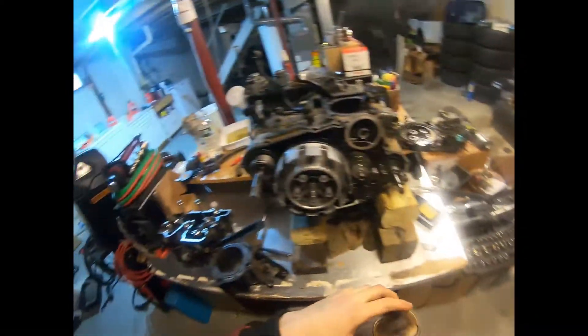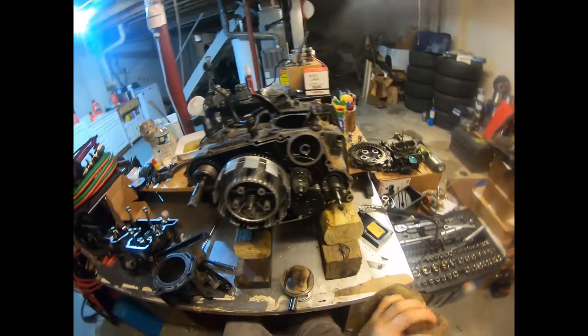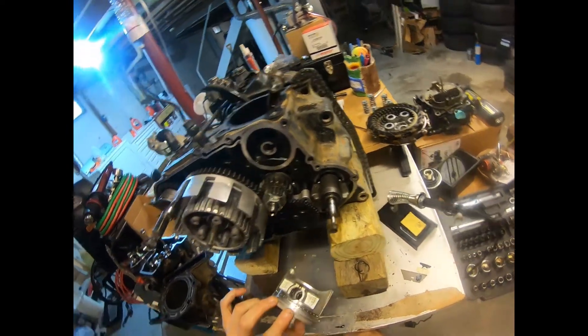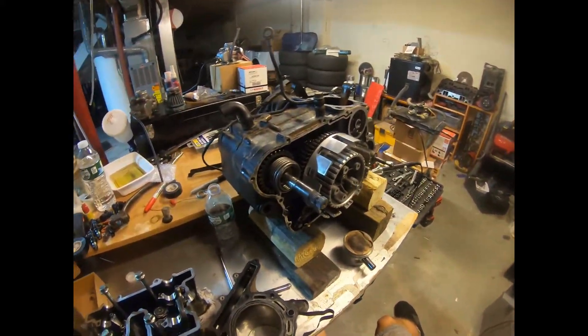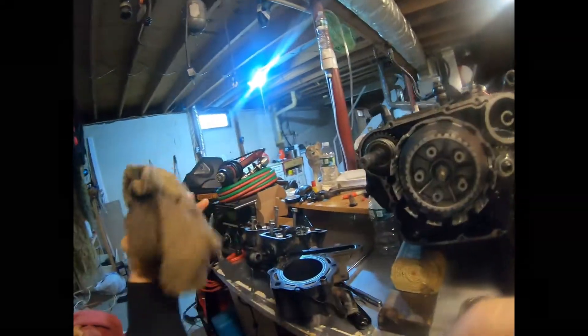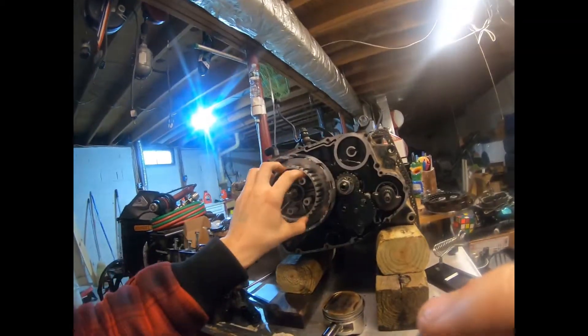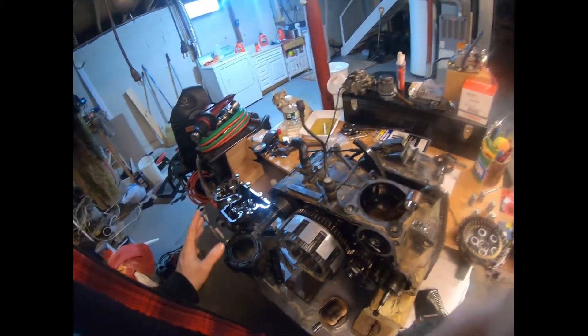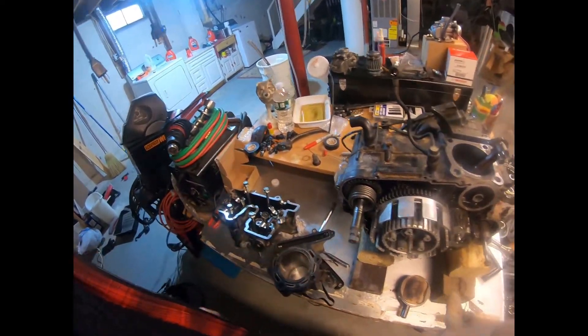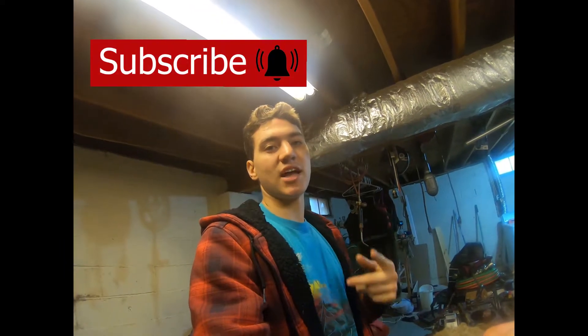We got the clutches out, we got the piston out, everything here looks actually really good. I thought I was going to open this up and it was going to be all black, with the rings maybe all burnt up - not looking good. The only problem I see is the valves, and honestly the valves could have been where the oil was burning from. So next video we'll probably be taking off the back cover, checking the fitment of the piston into the cylinder wall, and I'm going to find an engine shop to bore this out a bit. Please leave a like, comment below, subscribe to the channel, and I'll see you in the next one.